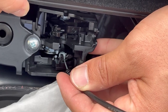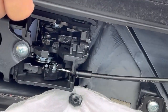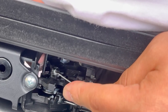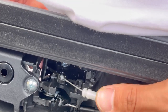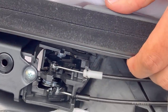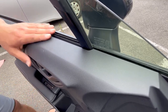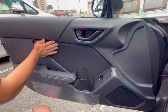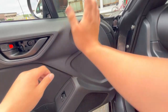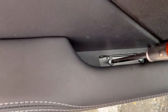For the door lock and door lever connections, the black one goes to the door lever and the one with the white end goes to the door lock. To install the door panel back, find the alignment by the edge of the door window. Once the door panel is attached, simply install the screws on the door handle.